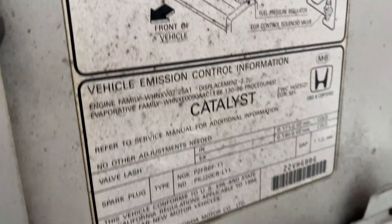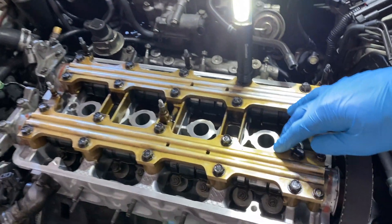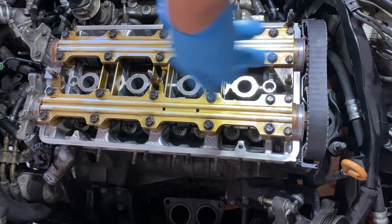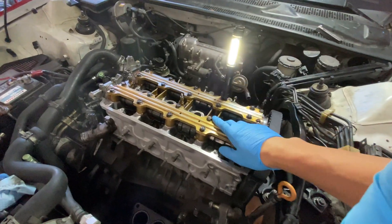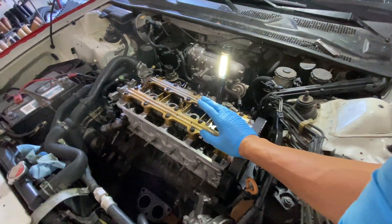On the hood there are specifications on clearance. I got to do it on each piston — the exhaust side has two per piston and two on the intake, so that's pretty much 16 valves I got to adjust. This is what's prolonging my progress, and it's pretty much preventative maintenance. If I don't adjust the valves, the same thing could happen again where the valves could overheat and crack. Doing this valve adjustment is gonna make the car run a lot smoother. If your car is pretty old, this is something that's recommended to do periodically — hit up your mechanic.